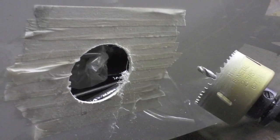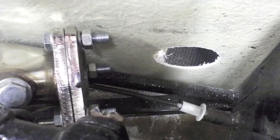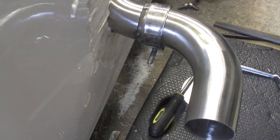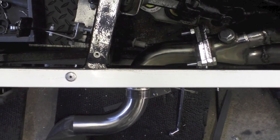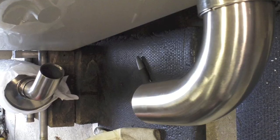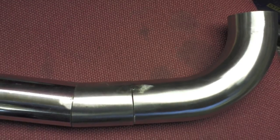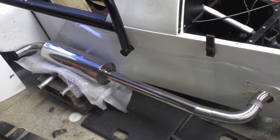So we bit the bullet and cut a hole in the fibreglass — this one's on the driver's side and the flange is quite close, so it's quite a tight bend to get the 90-degree bend out from that flange and through the hole. It's going to need a bit of heat protection. Cut down a sleeved expanded joint to then put another 90 on the outside of the car to reverse the pipe down the side. I bought some nice silencers to go on both sides, and had to put a little kink in — just an extra step — to get an extra bit of angle to line up with the silencers at the rear. It worked out pretty well.